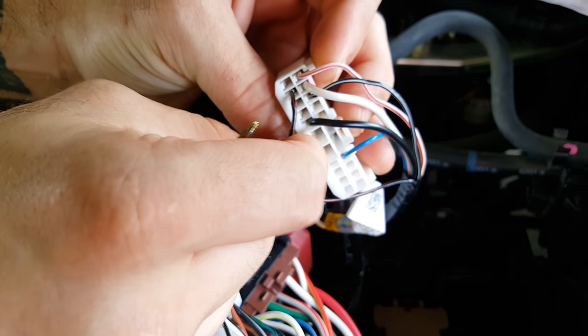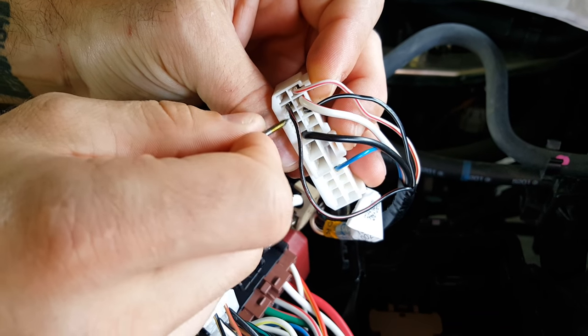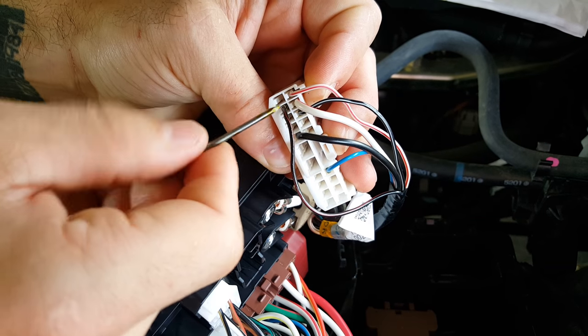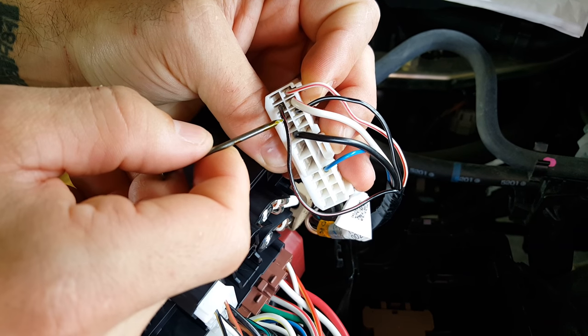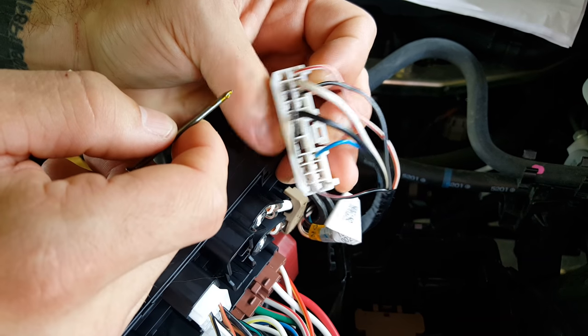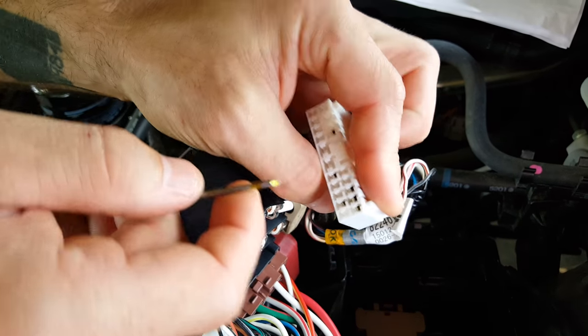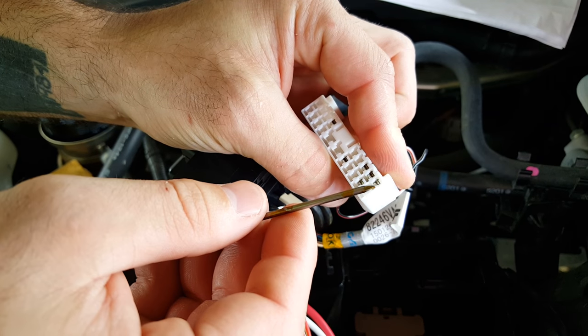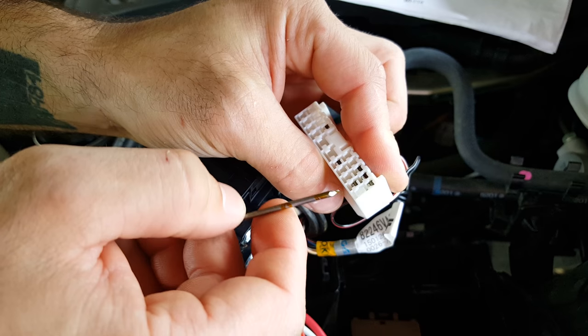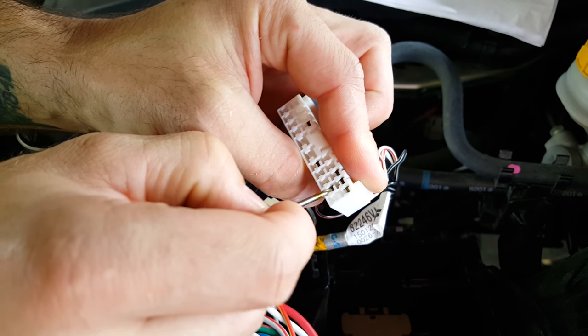You're looking for the black wire with the red tracer on it. I'm going to list a couple of images in the links below so you can look at the wiring diagrams and the connector pinouts. You'll need a sharp pick or something sharp-pointed like a small nail.